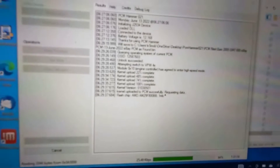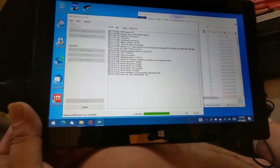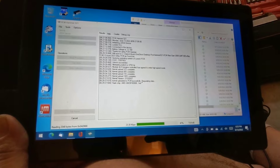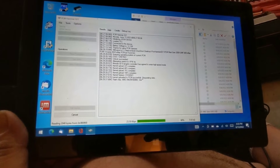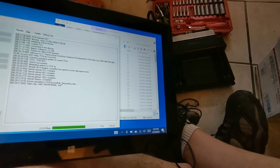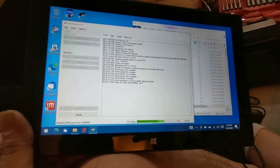That's kind of hard to focus on there, but we'll see what it's got loaded up in TunerPro and make sure we've got all the settings that are in there. I'm still waiting on the programmer to come in for HP Tuners, but we will successfully make an LS ECU with the 85 for the GMT 800.